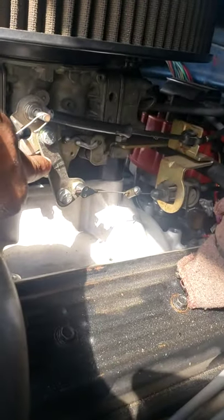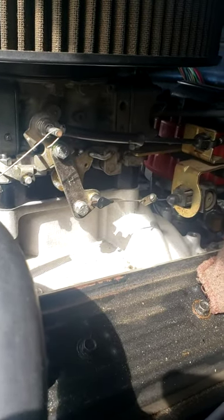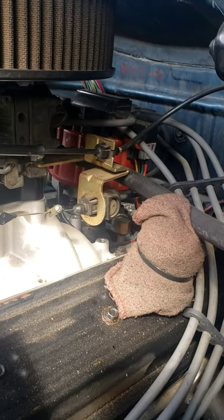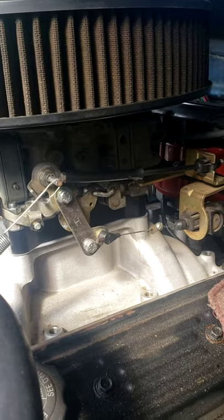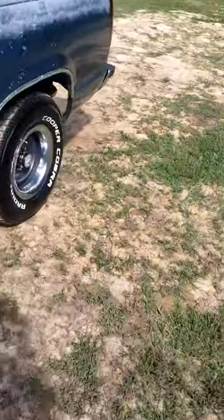It's got some shorter headers on it and two-and-a-half inch dual exhaust. I also had to get these brackets for the carburetor — one is a geometry bracket for the 700R4 with a lockup torque converter, which I'm still using, and the other is just a bracket to correctly run your TV cable and throttle cable. It makes it a whole lot easier to route things when you're switching to a carburetor setup.